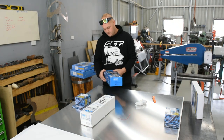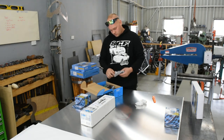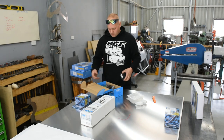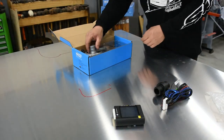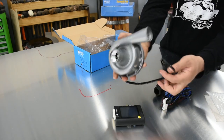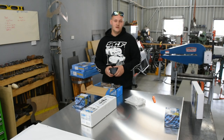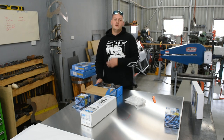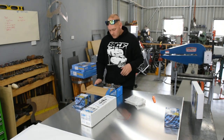Along with the fans, we also have the EWP 150 water pump, which is an electronic water pump. It comes with an LCD digital controller which helps regulate the flow of the fans and the water, and it all works in conjunction with one another. We're setting a coolant temp sensor either inline with one of the radiator lines or straight into the end tank on the radiator. It picks up the signal of how hot or cold the motor is and regulates it. We can also set it up to continue running the water pumps and fans after the car's been shut down — so you might have finished the skid, drive back to the pits, and keep cooling it down so you can get straight back out onto the pad after changing a set of tyres without it running red hot.